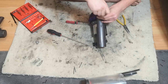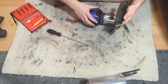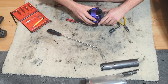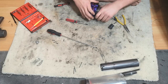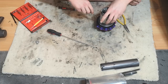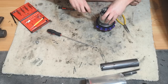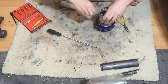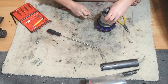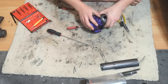That wasn't too difficult - it's the same way it connects as the V6: it clips in, pushes right down, and clips in just like the V6 did. I also worked out this seal comes off as well for washing. Now I'm going to take a slight hunch that now the screws are removed this is going to be the same as every other Dyson - a series of horrible clips somewhere but I don't know where, and I don't want to force it too much. You can see I can remove this annoying part by taking out this screw. There's the cyclone slide mechanism.